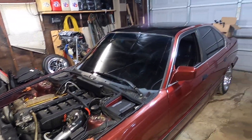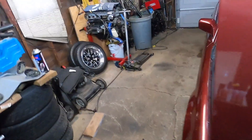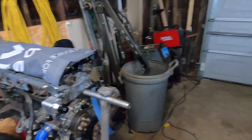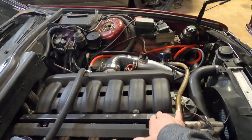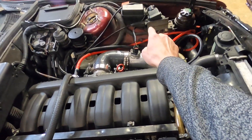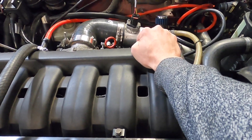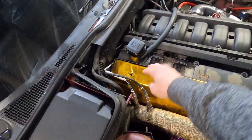We're here in Zach's lair. We have his turbo E30 and his thousand-horsepower 7M motor for his Supra under construction. He was nice enough to pull my E34 in last night. We have a few things to do: tap a fuel pressure sensor into the rail, add an IAT bung in the intercooler piping, block off the MAF since I won't be using that anymore, put the standalone in, and put in a new wideband and boost solenoid.